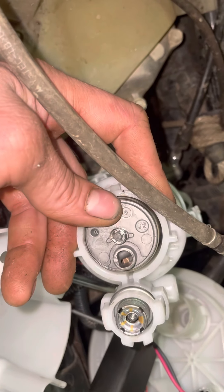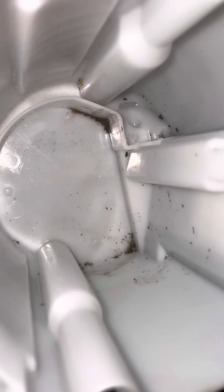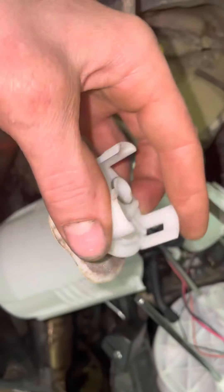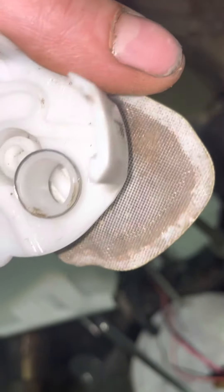I changed the fuel pump not that long ago — what a garbage setup. This is incredible, man. It baffles the fuel inside this massive canister, and the fuel pump clicks in there real nice. And there is that beautiful fuel strainer — it's not really a filter, it's more like a strainer. It's amazing to see how much dirt it strained out.